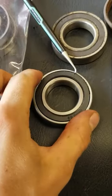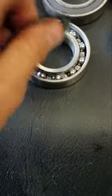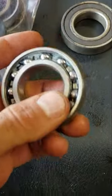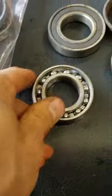Get the tip of your pick in there and pry it up. Do it on the outside, not the inside — you'll mess it up. There's no grease in this thing, and for a wheel bearing, that's unacceptable. I'm going to pop the other side and see how much is in there.